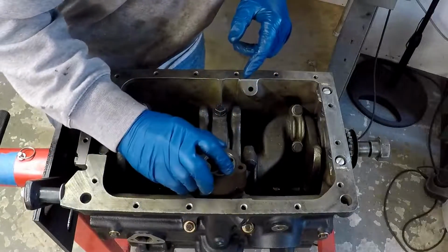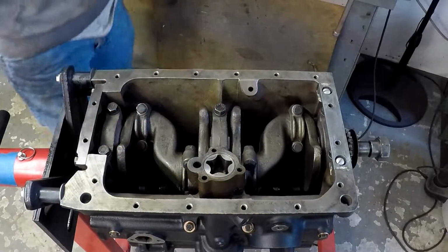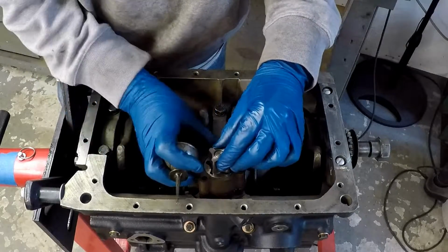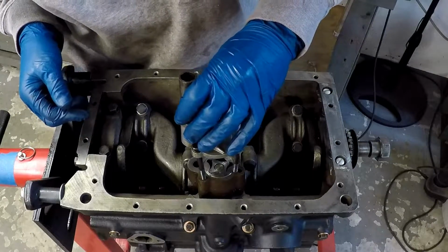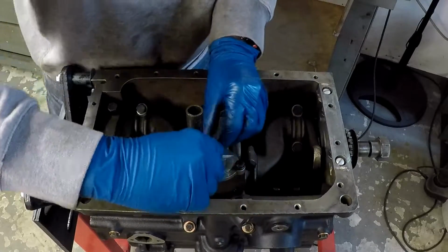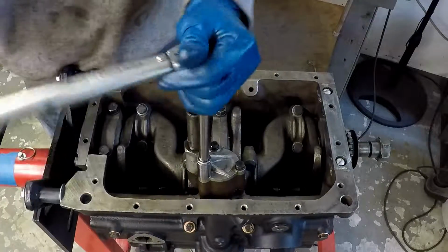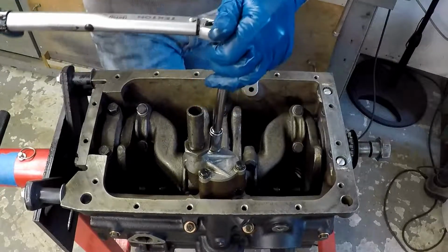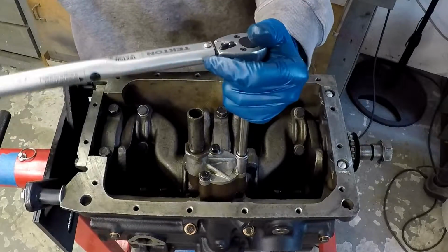So now really I'm just putting the oil pump body itself in. There's only one way the bolts can go in, so this is not a trick question here. Pre-lubricating everything just for ease of assembly. Main lobe goes in and the interior lobe. The cap goes on. There's a couple different types of oil pumps you can get. None of them are original to the Mark 1, which is what motor this is, even though I have a Mark 2 car. The pickup screen on the older ones is on the oil pump, and on the newer ones it's on the oil pan. So the person that had it before me took the oil screen off the pickup of the pump, and I have it on the oil pan.